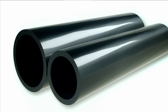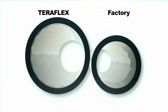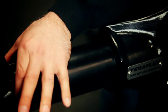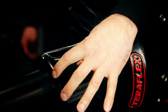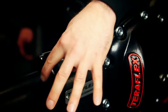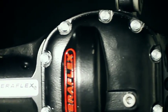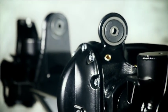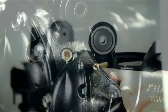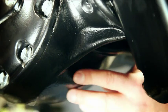This is quarter-wall, three-and-a-quarter inch DOM tubing. We've eliminated the common failure points you see on the factory housings right here with the larger tubing and bracket — you're not going to see it break there anymore. We've also extended the housing a couple of inches to reduce the moment arm, so it's not going to bend or break there. We've cast ribs into the housing to increase strength and prevent bending. There's also a control arm mount cast into the top that receives a factory bushing, the breather is in the factory location, and we've added a threaded hole for anyone who wants to run an airline for an air locker. The drain plug remains in the factory location.